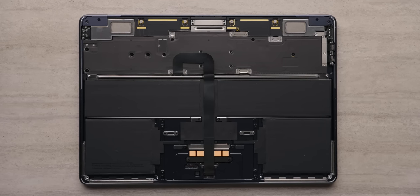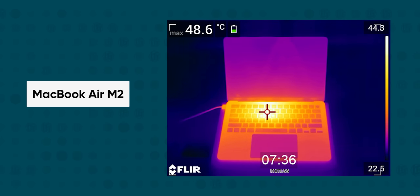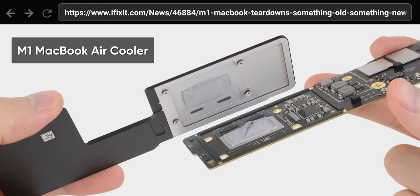As long as you have enough thermal mass to absorb your momentary heat spikes, you can count on long idle periods to dissipate it at your leisure. The M1 MacBook Air managed to strike this balance pretty well, performing at or near its full capability without overheating the chassis, unless you fired up something like Cinebench, Blender, or a 3D game. Unfortunately, that is not the case this time around. Apple has tuned the M2's thermal controls to maintain that same 50-degree surface temperature target, which is required by law, but almost immediately after being hit by any sort of load, the M2 SoC itself hits a whopping 99 degrees Celsius, because even the pathetic cooler in the M1 MacBook Air has substantially more thermal mass than this time around.